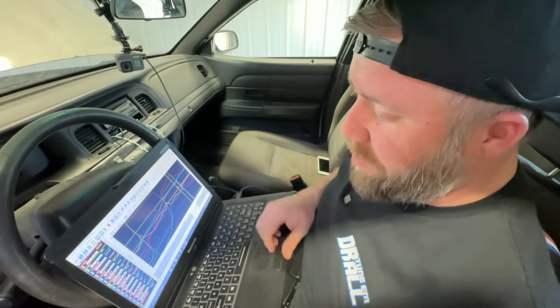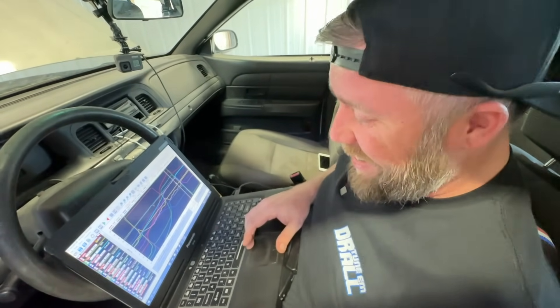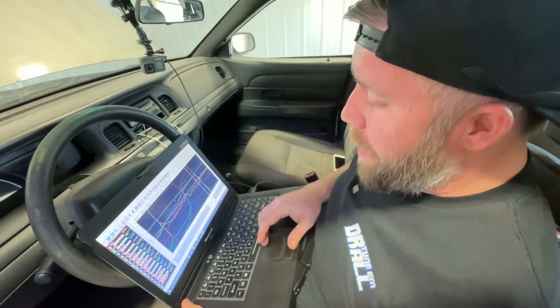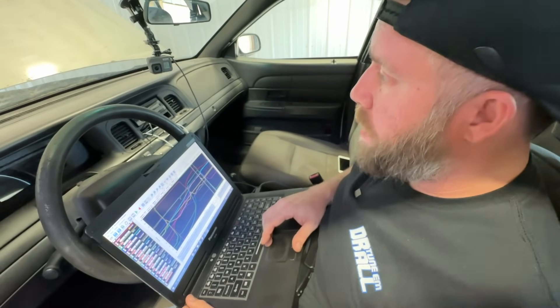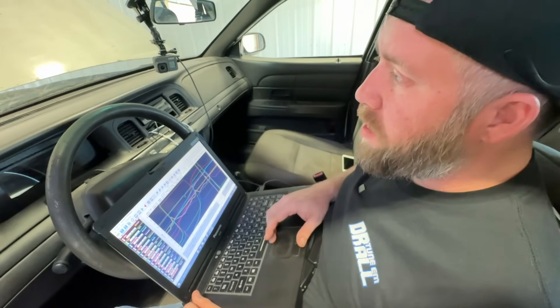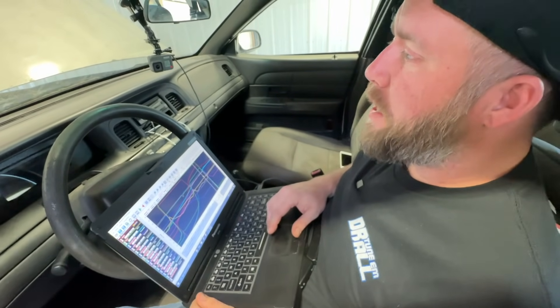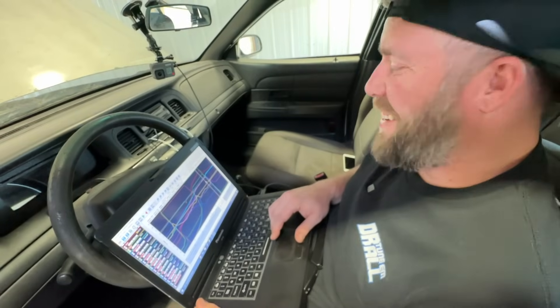Everything looks perfect. The recommendation for the next step would be a five-bar MAP sensor to remove the 26-pound ceiling. With the E85 quality in Michigan, we could safely run this thing on 28-29 pounds before we'd have to worry about flexing the cylinder head. On a race application we can usually go as high as 35 pounds before distorting the head, but considering this does hood rat stuff like towing jet skis, 28-29 pounds is solid. We're going for more boost again at the same timing to see what it makes — still approaching the two-and-a-half-bar MAP sensor limitation.